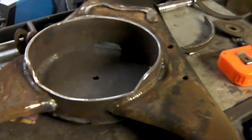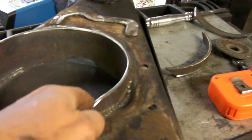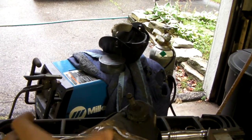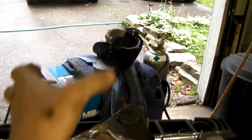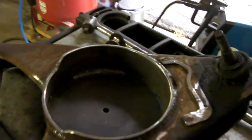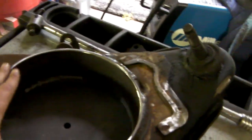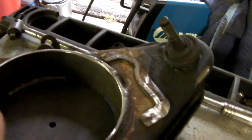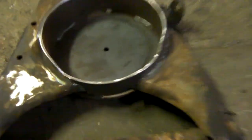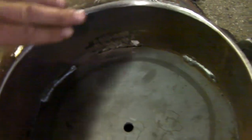Part 3 now, what I'm doing right here is you can kind of see in the back how I've cut the cups down. Just because like I mentioned in the previous video, as the bag travels, it's going to want to arch sort of this way. With this cup trimmed down, it's going to allow plenty of room for the bag to travel and not even think about getting close. I just want to be damn certain that nothing is going to rub on these bags. This one's all done. Took some 220 sandpaper and just sanded the lips of these really smooth.